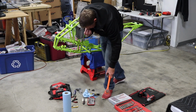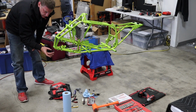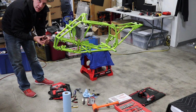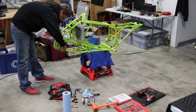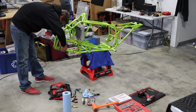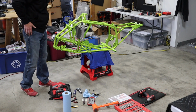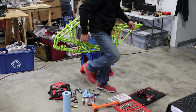That's in there. All right, so now that that's in place, then we take the seal, the top seal, solid. You're going to have an inner groove, and the top will be solid. So top goes in, and this you should just be able to push in by hand. And I just make it flush with the top. It doesn't need to be down, sitting on the bearing. This way it keeps more water out of the cup itself. So now we can take our steering stem.